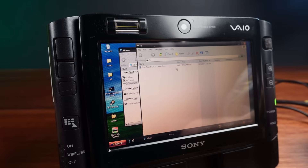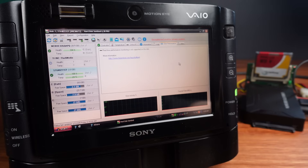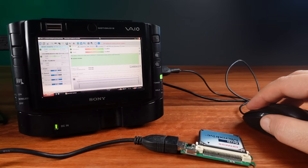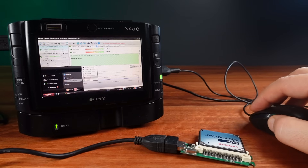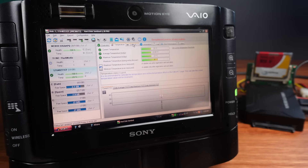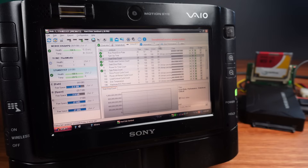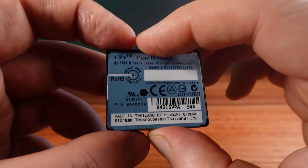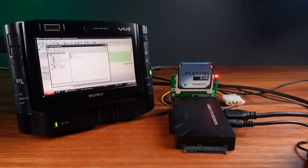I then set about doing some extensive testing on all these micro drives — I want to get a good idea of their condition, including reading their SMART health parameters. Interestingly, when I tested any drives using my working USB card readers, even though the drives work fine with them, I can't read any SMART parameter information out of the drives. Back to the full IDE interfaces, and the test results are in — I'm pleased to report they all work well, except for one. It's this 6GB full retail Hitachi drive — it spins up, but it doesn't seem to work. After extensive testing, I believe it has a faulty mechanism or maybe a faulty controller board.